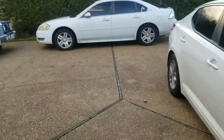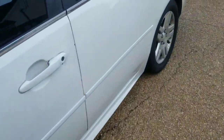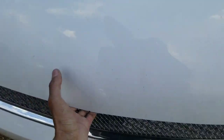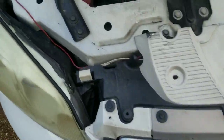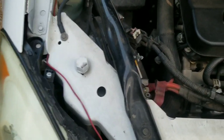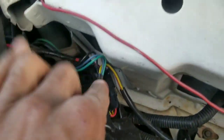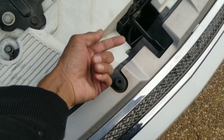I'm wiring it up to the park lights so it'll be on at night basically. Daytime running lights won't affect it or anything. Instead of just wiring it straight — since I'm gonna be taking this grill off in like another week or two — what I'm gonna do is run some wires from the harness all the way across, maybe just one wire, and I'll do like a little quick disconnect somewhere around here.